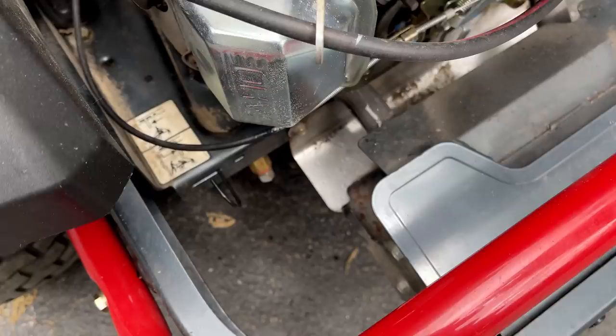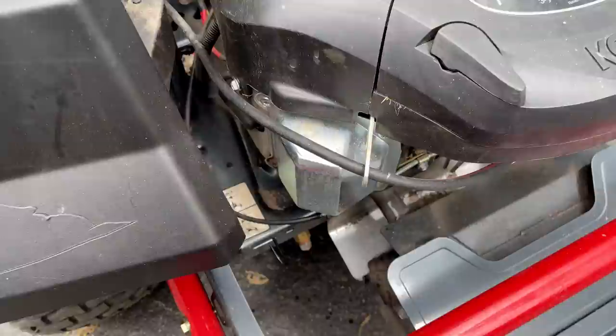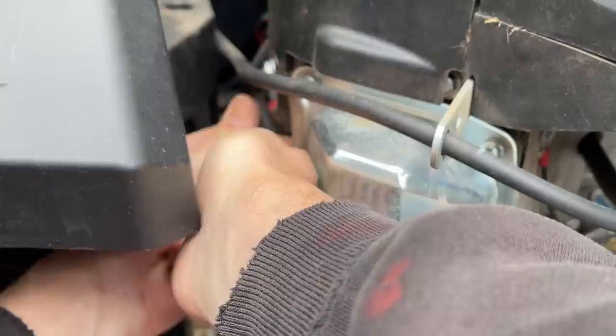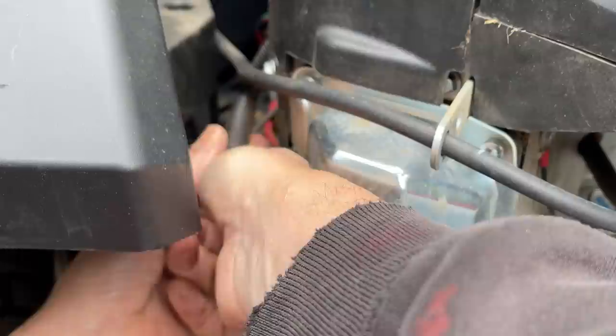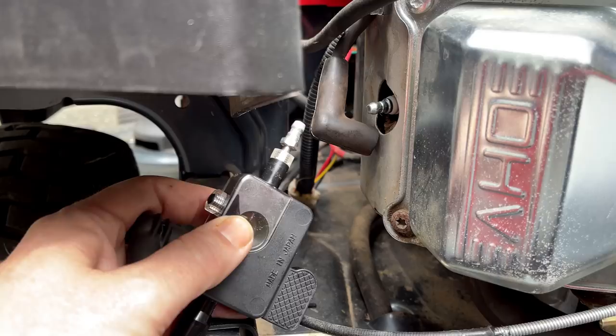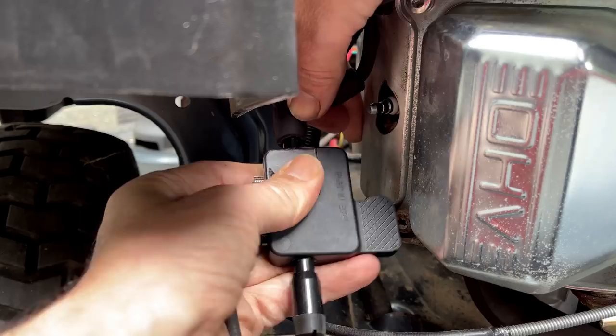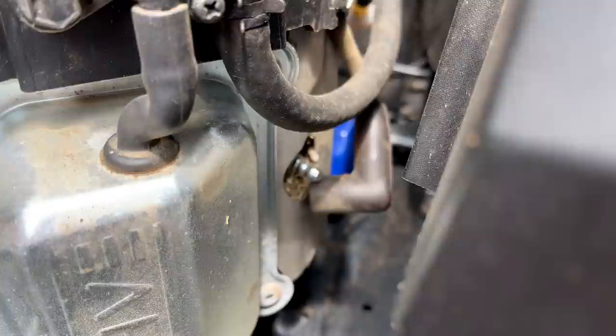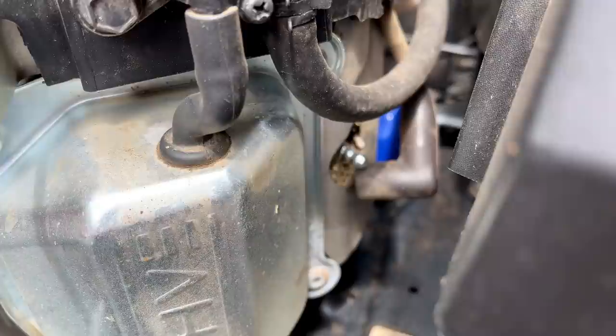And yeah, that cylinder there is down. So let's get the spark tester on there, see if we have any spark. It's kind of tight quarters in here. It's kind of hard to show you this angle here, but I did unplug the other cylinder so the engine doesn't start when I crank to test for spark on the left side.